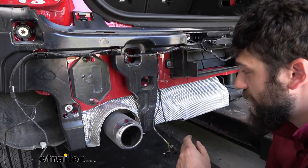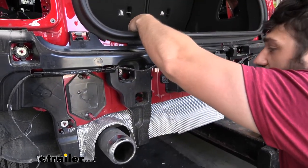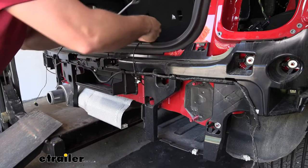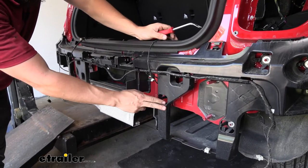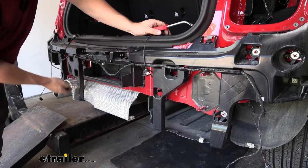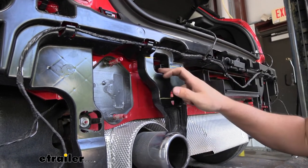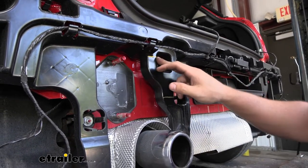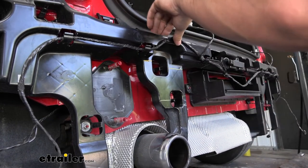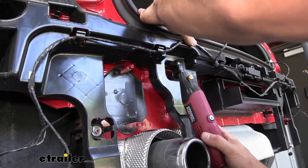Now we need to do a little bit of wire management. For our reverse sensors, we need to remove these from these little plastic holders and drape them up in the hatch, because we're going to be trimming these little plastic keepers to allow clearance. Our hitch is going to mount to these bolts, but we're going to have to trim out a section to allow clearance of our cross tube — we need to trim both of these little plastic holders. We went ahead and marked out where we need to trim. The guide in the instructions isn't super detailed, so we'll test-fit the actual hitch to make sure we have enough material removed. Be sure to hold the wire up and out of the way — you can even zip tie it if need be. Now we'll go ahead and take a rotary tool and make the required cuts.